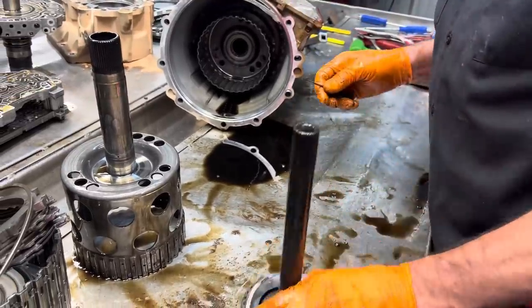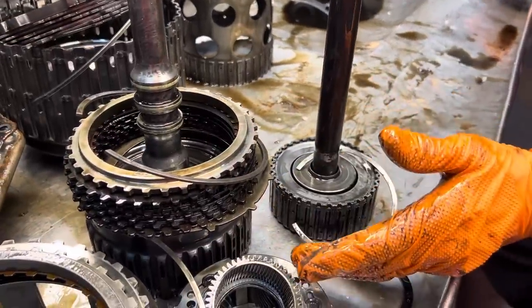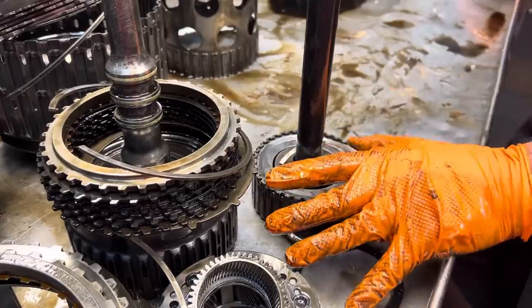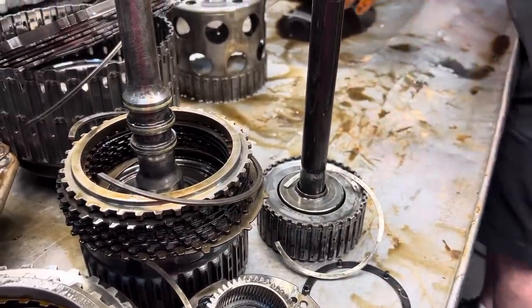Now, you can do a Sonnax upgrade right here to a billet shaft with the same clutches, or a billet shaft with Power Guard clutches, and there's multiple ways you can upgrade that 4.56 clutch drum. So